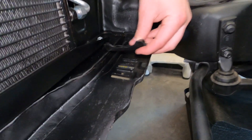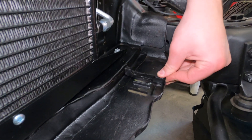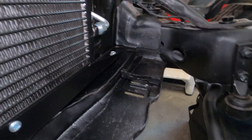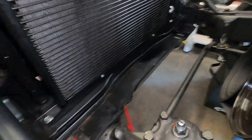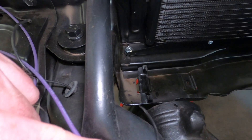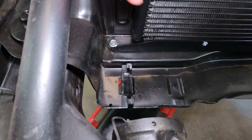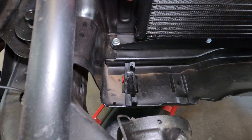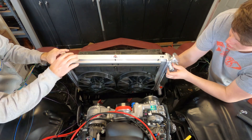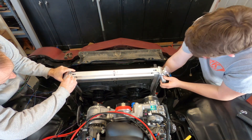Here's one of the bushings being installed. Notice that the part that's left — the half that's left of the cradle — is to the inside. And here's the radiator support bushing; it sits down there very nice and can't move around. The part that's left, the half that's left, is to the inside. This will be the first time we're trying to make it sit down on our newly shaved support bushings.